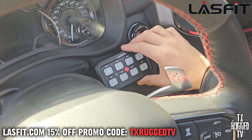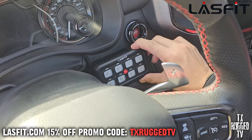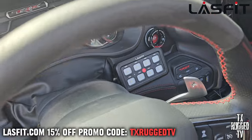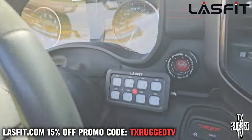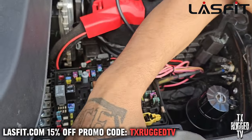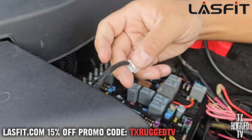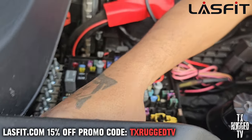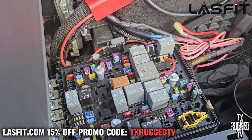Look at that — you got the factory bolt that holds the factory fuse box, loosen that one up, drilled a hole in the bracket on the bottom side of it, and then snuck it up through there, turn the bolt back on top. The thing is sturdy, ain't going nowhere. We just mounted the control panel right here — it looks sturdy, you can move it around if you need to move it a little bit higher or move it down if you don't want the light in front of your face, and you can still move your steering wheel. It's a clean install right there. In this box you have a little plug — it's got the single red wire on it. This is gold — this goes to the ignition, and that's what tells the controller when to come on and when the truck is on.